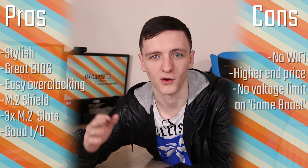On the I/O front, the triple M.2 slots make good use of the extra four PCIe lanes available on the Z270 platform. I like the heat shield on the central M.2 port since NVMe SSDs do get quite hot, though it's a little strange that they include three M.2 slots but only one heat shield. Also worth noting: this board doesn't have Wi-Fi, so if that's important to you it may not be the right choice — though you can add a PCIe or USB Wi-Fi adapter. It's a stylish board, slightly more tasteful on the LEDs than Gigabyte's offerings, and you can control the LED zones in both software and the BIOS.